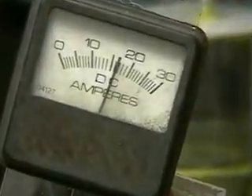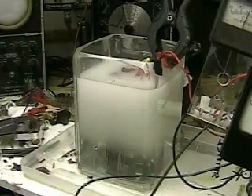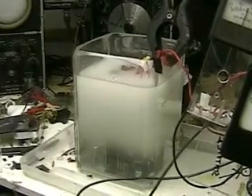We're testing this amperage-wise to see the amount of amps it will carry, which is about 16 amps. There are no electrolytes in the water and we're at 12 volts. The ideal situation is to not use any electrolytes, which we're not using in this system. This system was installed in the car before with 11 plates; with the 15 plates, bringing it up to 16 amps at 12 volts, installed in the car we're going to be putting out with the alternator between 14 and 16 volts.